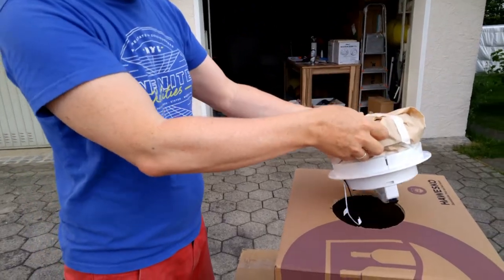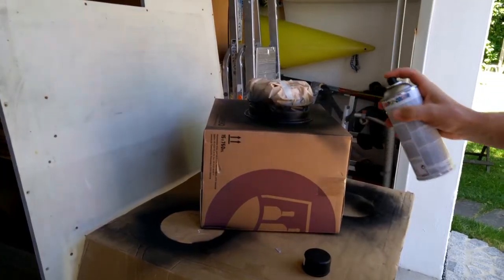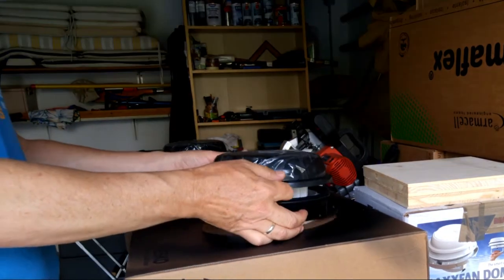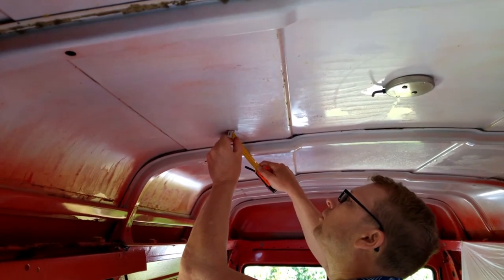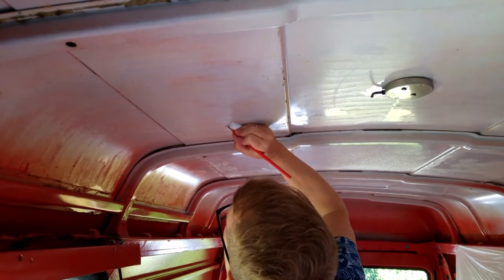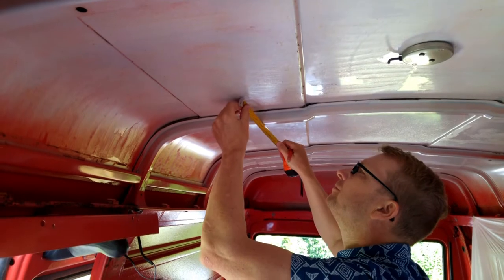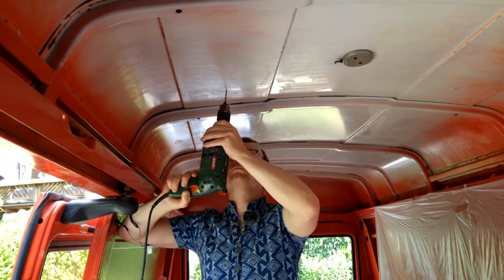The cap is originally black but the base is only available in white, so I have sprayed it black to match the color scheme of the van. The white inside is okay because white will be one of the interior colors anyway. Now I need to measure twice or more to get the hole in the right place — especially we have to be careful not to hit one of the internal structural beams. I will cut the hole from outside but I want to drill one small hole from inside first to avoid wrong measurements on the roof.